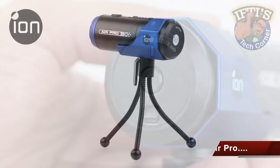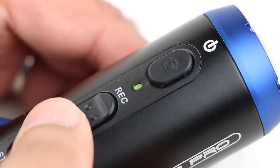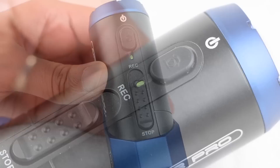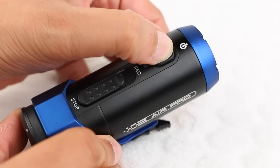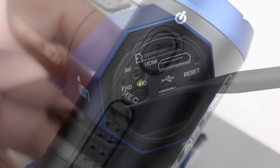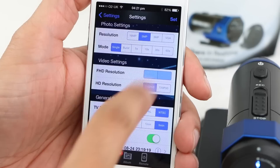Instead of a blinking red light to indicate recording status, the ION Air Pro uses vibration feedback to let you know when it's recording. Move the slider to the record position and you'll feel the unit vibrate. Press the shutter button and you'll feel another vibration indicating a still image has been captured. There's also a single LED on top that glows either green for standby or red for recording. The controls are easy to find, and the vibrations are better suited for a camera strapped to your head, where you'd likely not be able to see the blinking status light. Shooting mode is the only thing you can control on the camera itself. The switch toggles between Full HD or HD modes, which can be customised when connected to the WiFi app. The still image shutter can also be adjusted for single, burst or time-lapse modes.